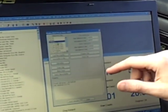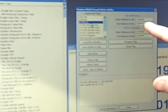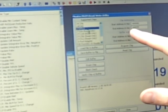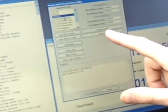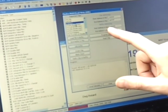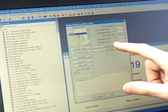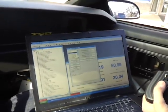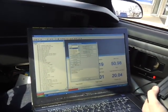With a 512 chip, the starting address is 0x008000 and the ending address is 0x00FFFF. The buffer addresses are all zeros across, and the ending buffer address is 0x007FFF. What you want to do next is make sure you erase the chip first — make sure there's nothing on it — so you erase the chip and hit Blank Check.